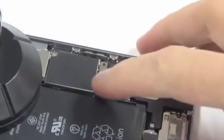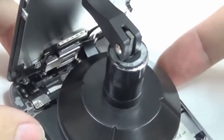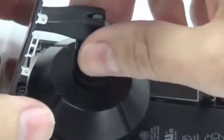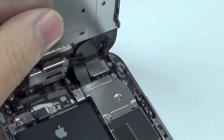So after you have removed the connector, you give it a short press on the side, not like the iPhone 5 on the top, on the power button. So then you're sure all the electricity is out of the board and you can't short it anyway. Let's put this plate aside, and now we continue removing the display.